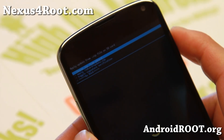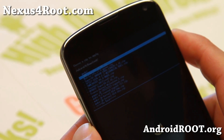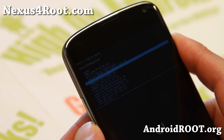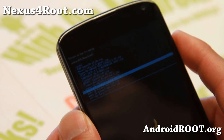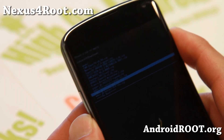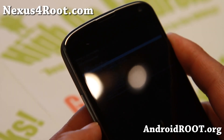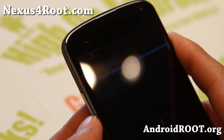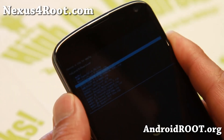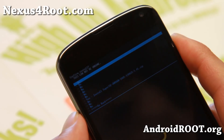Go use the install zip from SD card option. Choose it from SD card. Go to your zero folder — you probably downloaded it to your download folder — and go find the ROM file. It should be called the Mako 4.3 rooted signed dot zip. Go ahead and install that. I'm not going to do it because it's going to take forever. Then go ahead and also download and install the file called SuperSU JWR66N — I'll have the links to it — and then go ahead and install it.